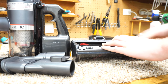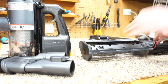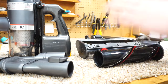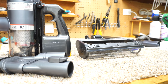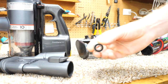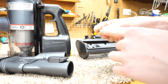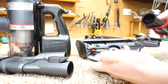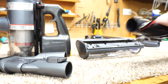If you want to change a part on here, this is sold in two ways: you have the cleaner head, and you have the brush roller. That's it — you're not changing anything else. I will say, as I discovered earlier, this cartridge bearing — you could probably match up this bearing by itself on eBay or Amazon through the number on here. Cartridge bearings are standardized. But chances are, if that bearing's bad, so is the end cap and brush. So I would rather get that as a whole assembly, personally.